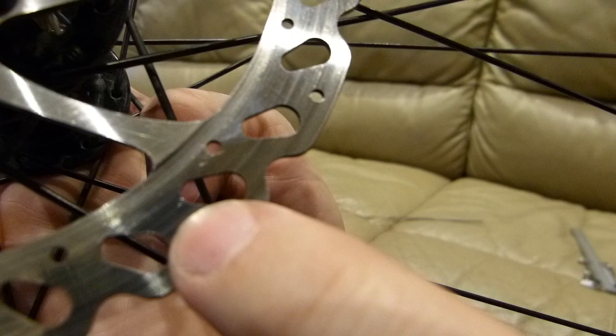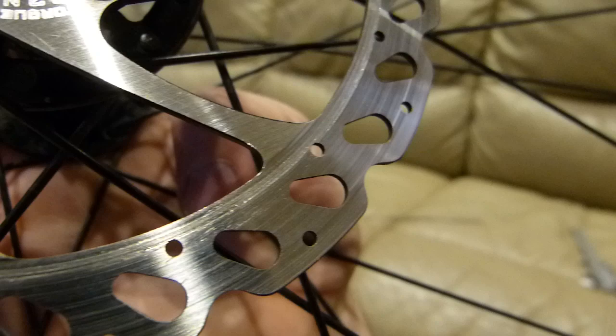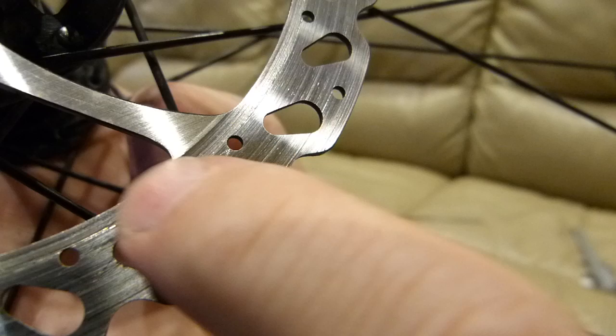You can see there are long circular marks in it as it comes into contact with the brake pad, and that little bit of scratch that I did was really like 5 strokes or whatever. I did it in front of your very eyes. I'm not concerned about those hairline scratches that I put there with the corner of the file, because the surface of the metal is made to wear anyhow, but I don't want a lump protruding out from it.